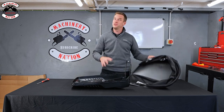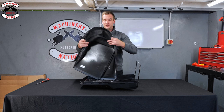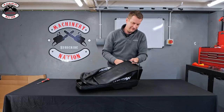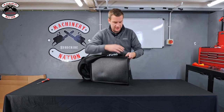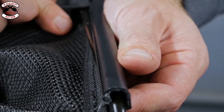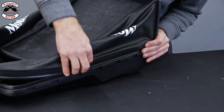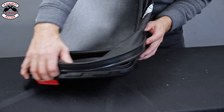Now the frame is in, you can put the grass bag on — probably the most fiddly part of the whole operation. Make sure the Mountfield logo is on the outside of the box, not the inside, so it's the right way around before you start. You've got plastic rims along here which slot onto the bars — make sure you've got them pushed in all the way around so they're coming through the metal pole, then push on all the way along and they'll just clip on. Do the same on the sides, start at the corner and once you've got the corner started you can push them on. Once you've done all three sides, the rubber edge needs to slot into the groove all the way around the outside of the box. Gradually place it to start with — don't push it all the way in, just make sure you've got your corners and everything correct.